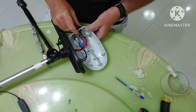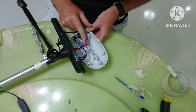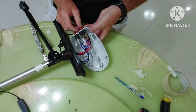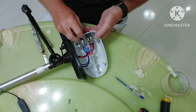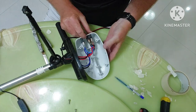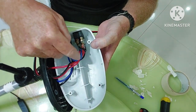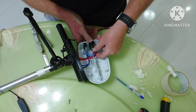Push the switch back into place until it clicks — there are four tabs on it. Make sure the wires are not in the way of anything. They have to be on one side of the plastic in order to fit in snugly. I heard everything click — it's in. As you can see, there's a gap or hole right here in the plastic. That's where all the wires should fit through. They shouldn't come around the outside — they should all fit in here so nothing gets pinched when I close it.